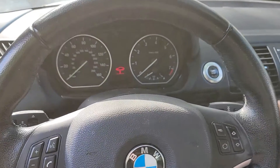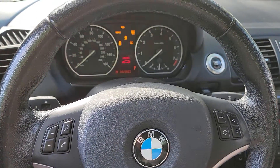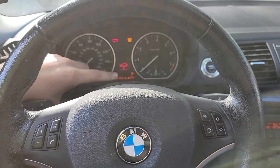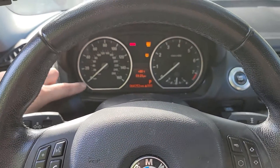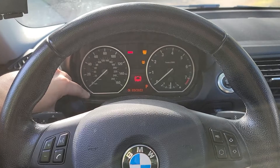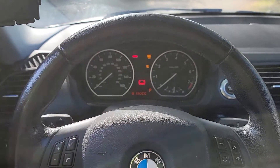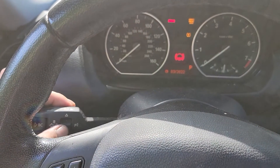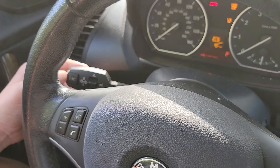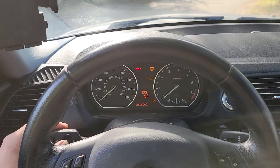With the sensor wires shorted, I need to reset the computer inside the vehicle. I'll insert the key, not put my foot on the brake, and tap the engine start button without starting the engine. I wait until all service lights go off and it returns to the clock display. Then I hold down the button in the corner of the gauge cluster for a few seconds and release. I scroll through the menu using the toggle button — that's the front brake pads. To reset, I hold the BC button down, give it the option to reset, and that one is reset.